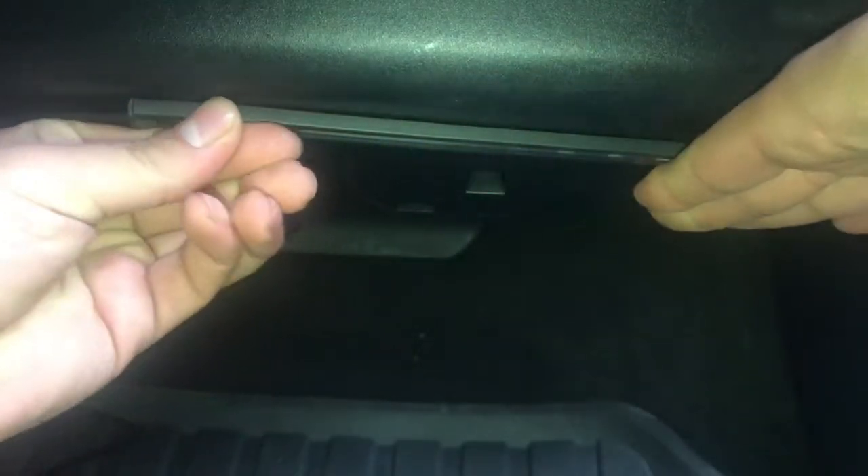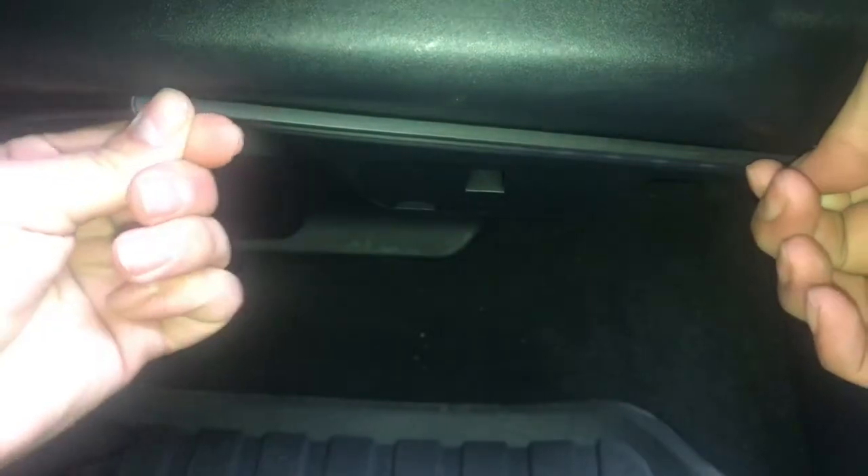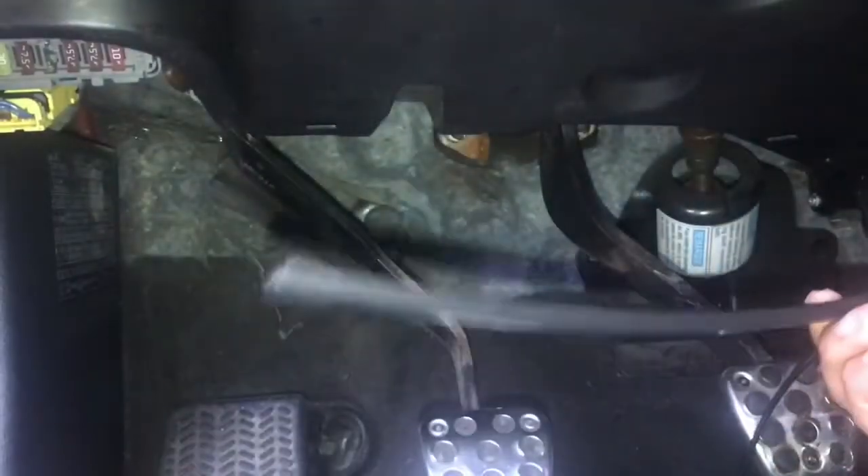I feel like that would be perfect right there. I'm putting it a little bit high because on the bottom it's only gonna stick like half of it and I don't want it falling off. I prefer to have it a little toward the edge but make sure it stays on there. Once your LED strip is in there, just take the cable back there somewhere — and as you can tell, right off the bat you can't even tell there's a cable. All right, now we're doing the driver's side. They don't have to be completely straight — once the light is on you're not even gonna be able to tell, as long as you get enough of it to stick.